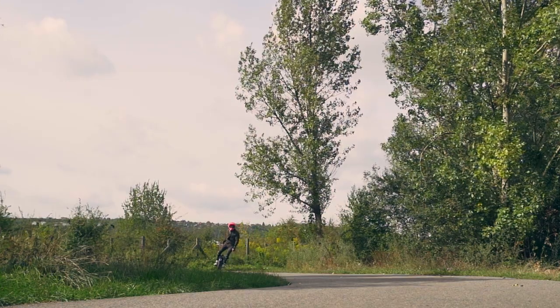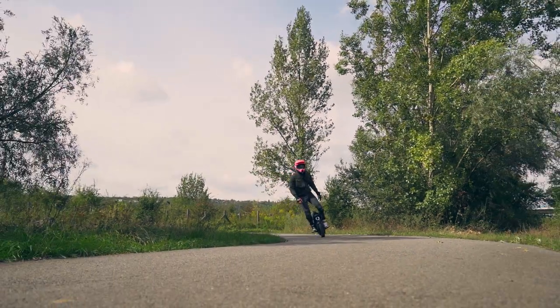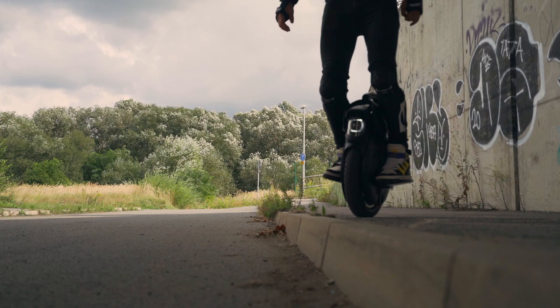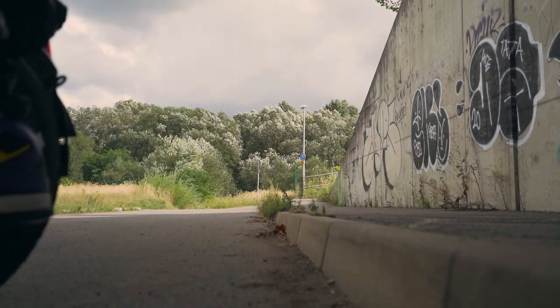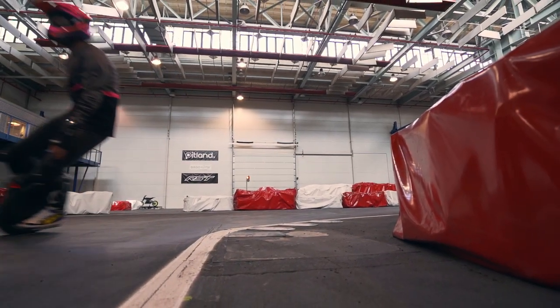One more thing that I'm a little confused about: even though it has the same tire as the Gotway MSP, it feels a little bit different. Cornering sensitivity — I like an aggressive riding style and love to corner at high speeds. With the V11, I cannot name the exact reason — maybe it is the high pedals or too soft suspension — but I do not feel the same stability when cornering as on other devices. The suspension is currently at 120 psi for my 80 kg of weight, so maybe we will need to change it somehow, or maybe it is the tire pressure.